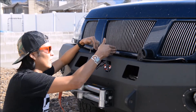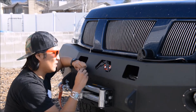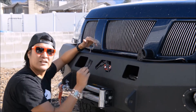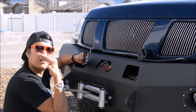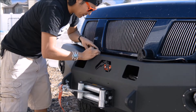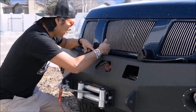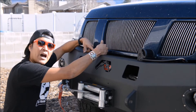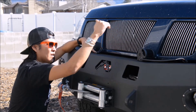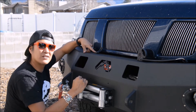So I'm going with seven inches from my center line mark in both directions. One of the most important things is that your bracket is also the item that needs the most clearance, because your light is going to be in front of the bracket. What I did was use the bracket and measure from the back side of the bracket to the front part of the Armada right by the grille — about a half inch. I did the same thing on the other side at my seven-inch mark. That's where I've got my plans to drill, and that's pretty much the next thing we need to do.